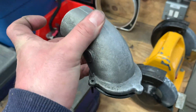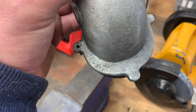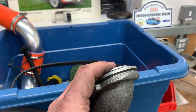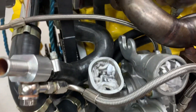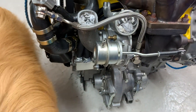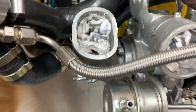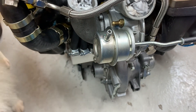This is the air intake — I'm going to take that knobble at the bottom off and chamfer it at an angle to make the pipes flow nicer. I'm going to do that on the bench grinder. And there we go — just a simple chamfer to give the pipe a bit more room to flow. With the air intake fitted back on, I'm really pleased because the pipes take a really nice smooth curve now with no sharp edges. It's a lot better than I expected — a big improvement on how it was before. I've had to shave a little more off the elbow for better clearance, but it still seals up nicely because the part I was shaving has nothing to do with the sealing face.